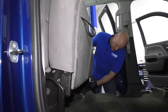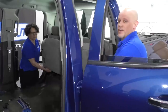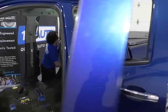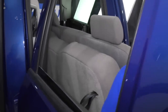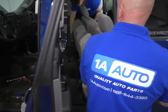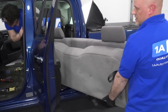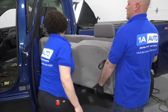It's just lifting up from the backside of the bracket, so just be aware. Now we're going to lift it out. It's a good idea to grab a helper because this seat is very heavy. What we're going to do is fold the seat in, grab underneath, lift up, and then slide it out one of the doors. Place it down — it's mostly awkward; it's not wicked heavy.